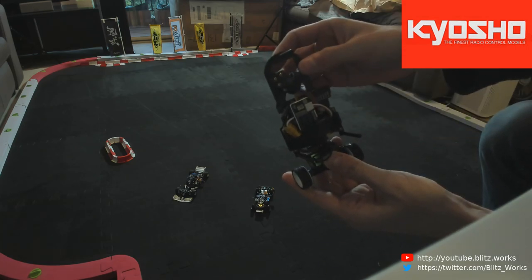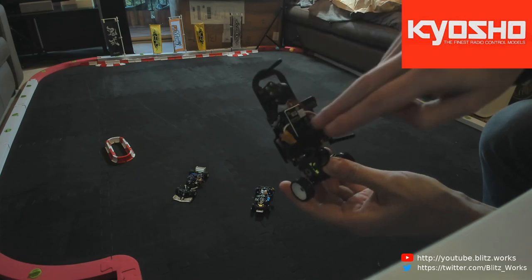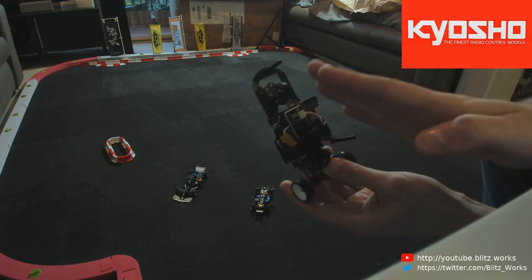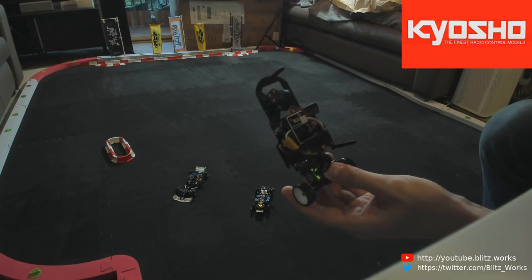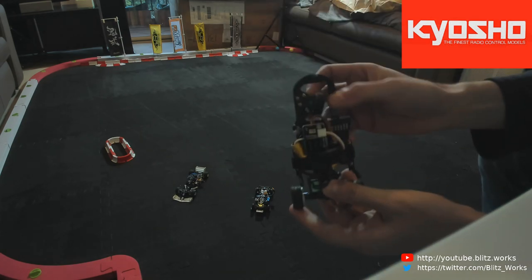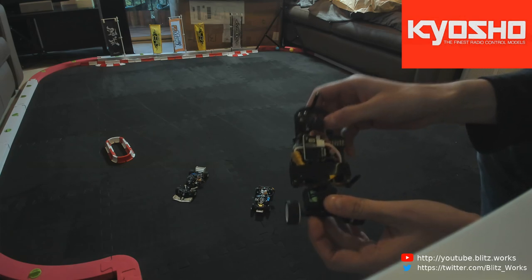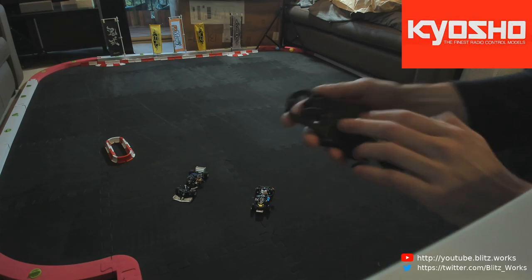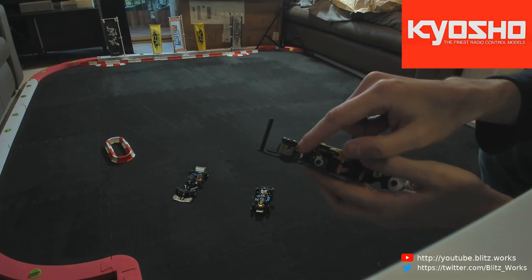With the steering arm running almost straight up at this angle, I've had to back out the steering angle a couple of degrees because when it's perfectly straight the servo can't push the wheel back out — it forces the wheel forward rather than in a rotational motion. You have to be very careful with your endpoints on this vehicle. Once you dial it in, it's very capable.